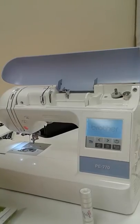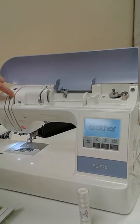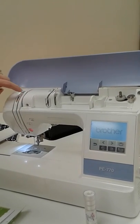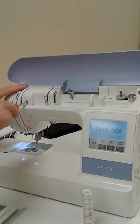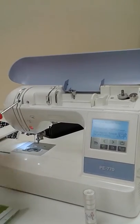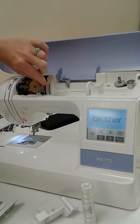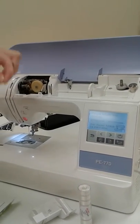Right when she brought it in I noticed there was one little problem — there's a lot of thread right in here. That's your tension disk, and because the threads have been breaking a lot, she's had some remnants of thread get hung up in this area. We're going to remove that first. In prior videos I've talked about how you can unscrew this screw here and pop this little cap off. You wouldn't think that just something this small would cause such a big problem, but it does.